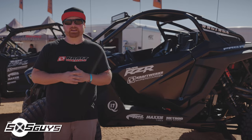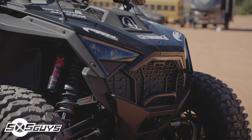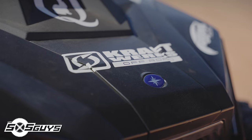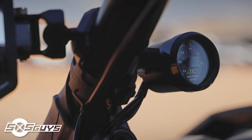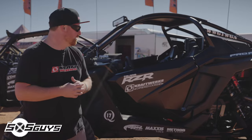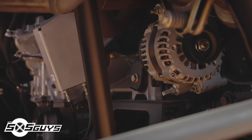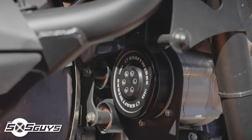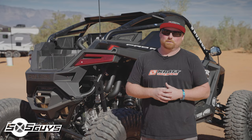Now you'll get a sneak peek at the world's only supercharged Polaris Pro R. This is a prototype right now — we're coming to market with it but we've been in development for the last few months trying to get the ECU cracked. As far as we know, we're one of the few still using the factory ECU with anything boosted. We're displaying our low-boost option here and that's on full stock internals — no need to open the motor. To adapt the supercharger, we relocated the alternator to the driver's side. The supercharger sits on the passenger side, both running off the same crankshaft pulley. We also added an auto tensioner for the belt instead of the stretch-fit one from the factory.